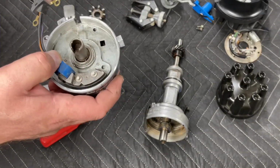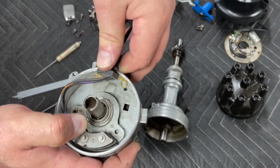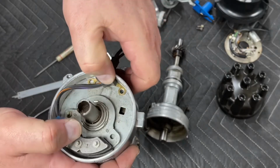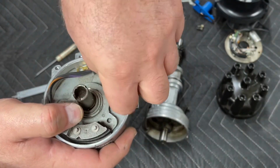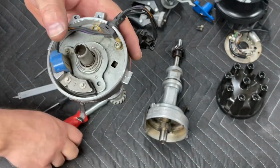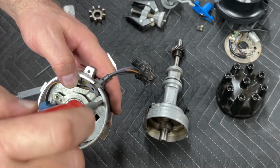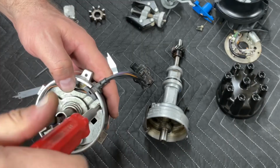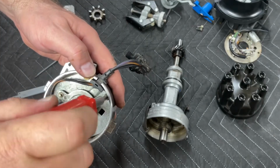And then we're going to insert our electrical connection, because remember, this is held down by the second screw, and the second screw can now be installed. If you just put the screws in straight away, your electrical connection won't fit properly and it'll want to flop around. So you go ahead and put this in.